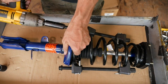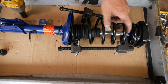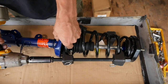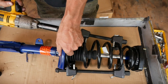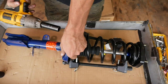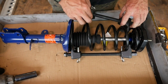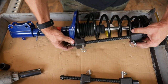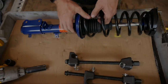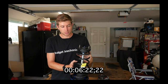As we're releasing the pressure, make really sure the end of the spring is sitting in the little pocket in the rubber as well as in the pocket on the metal, and that it's seating properly around the collar — not hanging up on something that will pop loose later. Do a little bit on each side. Obviously don't get your fingers stuck between the spring and the strut — that would hurt. Detach the strut compressors. There you go, it's all back together and no fingers were lost in the process — so that's a win. Hope this was helpful, see you next time.